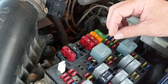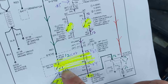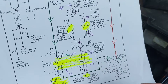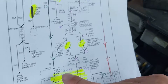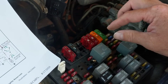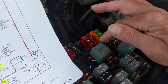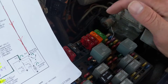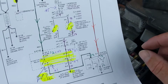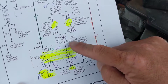I have a wire that I put in the terminal. I put a wire in terminal 87 — the one going to the starter — which is the most important. I put another wire in pin 30, so I'm going to get 12 volts there regardless because it's always connected. I also put a little wire with a resistor. These are the two terminals we're most interested in: 87 and 30. We want to get the voltage as close as we can in circuit with the relay activated — that's number one.